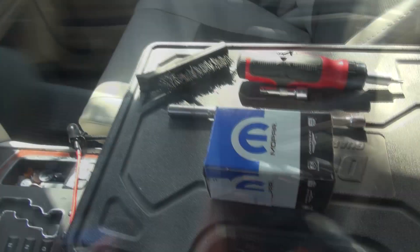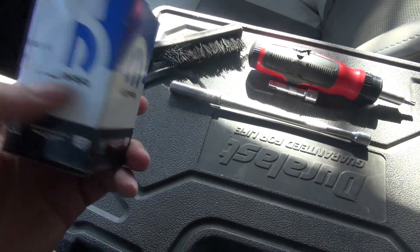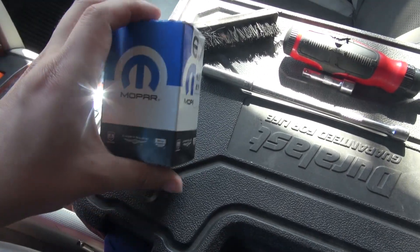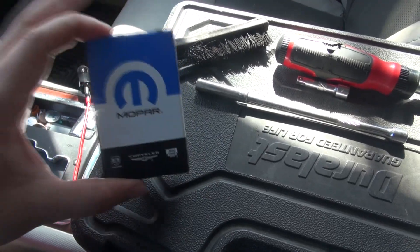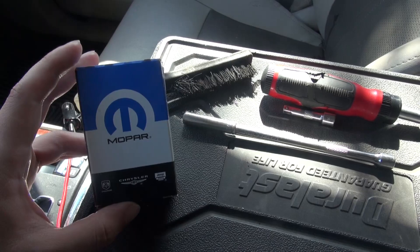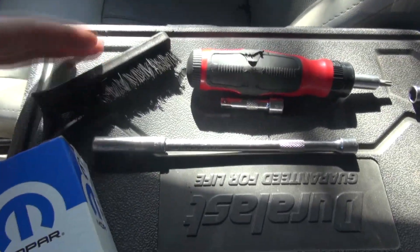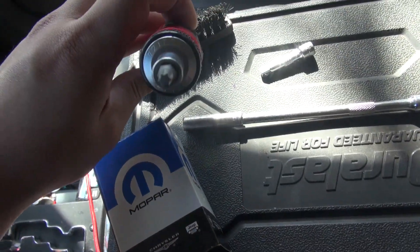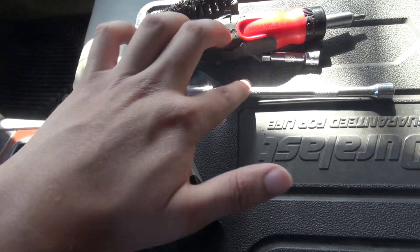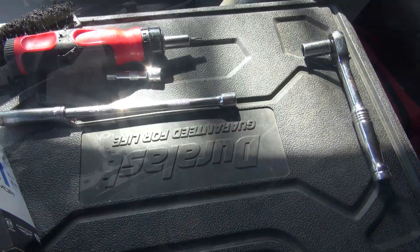I've turned off the car. What you're going to need for this repair is your throttle position sensor. I would suggest you use a Mopar part — I'll have a link in the description. There are cheaper alternatives, but with my experience with Jeeps, just buy the Mopar parts and you won't have to worry about it. Cheap parts might work, but most likely the issue will come back later. You'll also need a brush to clean things up, a screwdriver with a Torx 25-bit, an 8mm socket, possibly an extension, a wrench, and a 10mm socket.